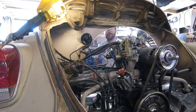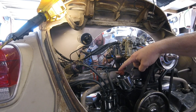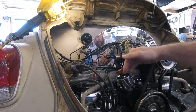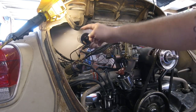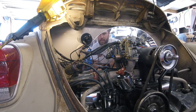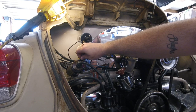The first thing I did right off the bat is I obviously took the deck lid off. My electronic distributor that was in this just wasn't giving spark — it was probably the sparker that burnt out or something like that. I tried different coils, which is why I have different coils plugged in right here. In the end I just bought a new coil and a new distributor on JBugs. So I'm gonna take this coil off and unbolt all the cables from this master bolt wire connection here.